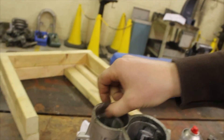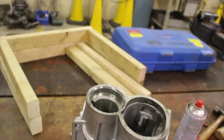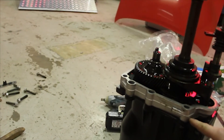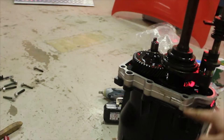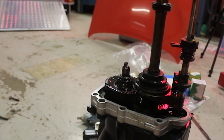We managed to get the bearing out of the end of the gearbox shaft — the tail piece of the gearbox — but it was a bit of a pig. We ended up having to take the whole tail section of the gearbox off. We nicked it a couple of bits there but it should sand out. Unfortunately we've cracked that open so I want to get a new gasket for there, and then we can put all this back together — fingers crossed it doesn't leak.